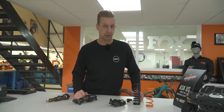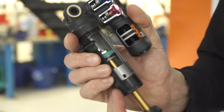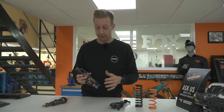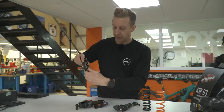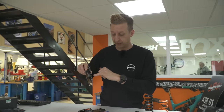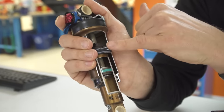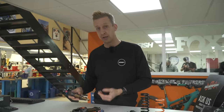Because your spring medium is on the outside with a coil shock, the damper unit is just on its own. It has no additional seals — it doesn't need air seals, only seals to cope with the oil. You've got your shim stack on the inside for rebound and compression, and the damper rod basically travels through that oil. On an air shock, there's a lot more going on inside — you've got your air chamber, your oil chamber, a positive air spring, a negative air spring, and of course the oil, all inside the shock body, meaning more seals. You could arguably say a coil shock could work longer with less routine maintenance because of less stiction or friction in the system. With an air shock, you're going to have to look after those seals a bit more, keep everything clean and lubricated.